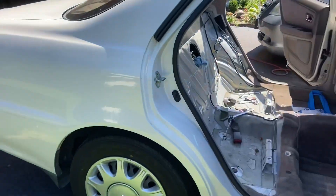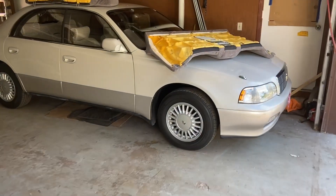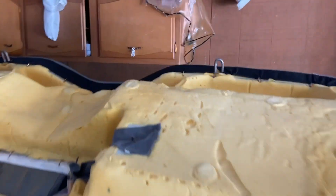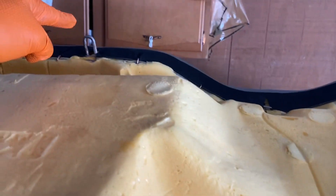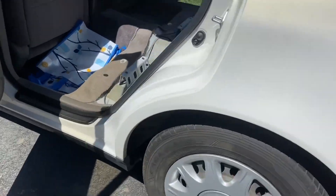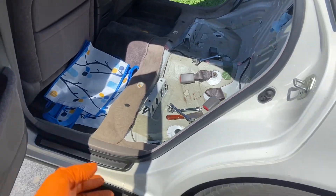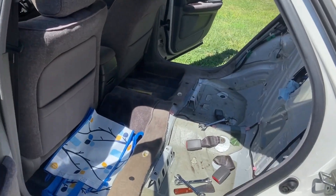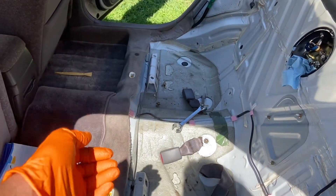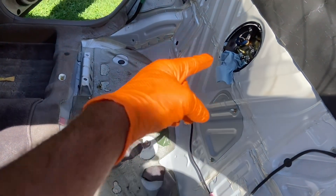First of all, you've got to take out the back seat. I'm going to show you sitting on top of this Crown Majesta — this is my wife's personal car. The bottom seat part your butts on, there's that hook and that hook, and all they do is pop into those slots. So you just got to grab the seat and yank really hard — obviously not like King Kong, or perhaps I meant the Hulk — you don't want to break the frame. You pop that out, pop that out.